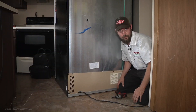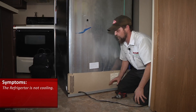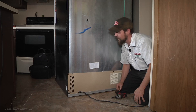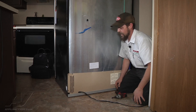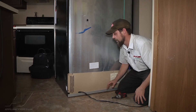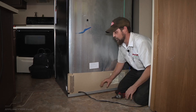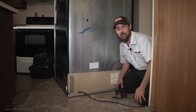We were on a Frigidaire refrigerator with the initial problem of no-cool. When we originally arrived, we could hear the compressor run and then heard a click and it shut off — that means it was clicking off on its overload. We checked the overload and found it was bad, then checked the compressor to make sure all of the windings were good. So now we've come back with new starting components. We're going to install those and then take a current check to make sure that the compressor is running at the right current.